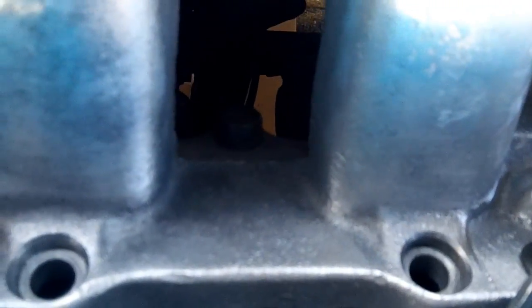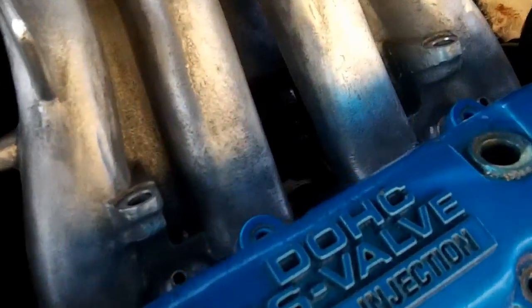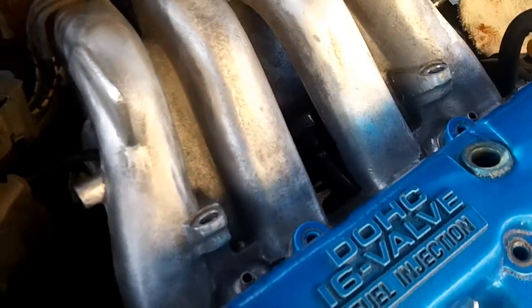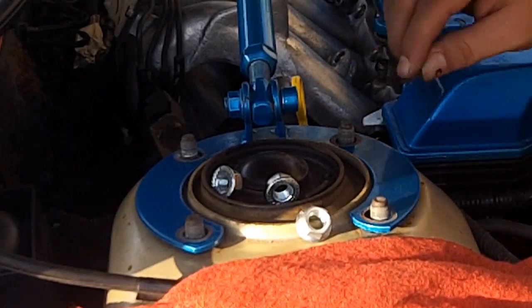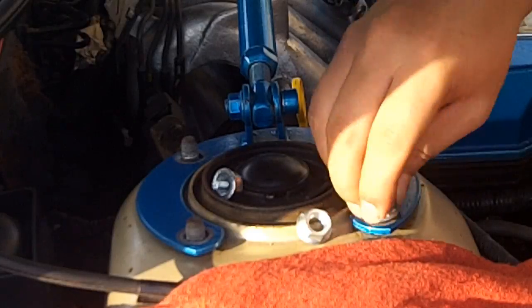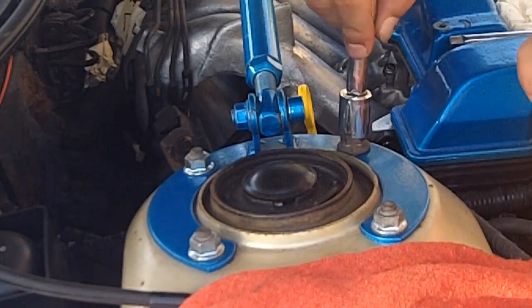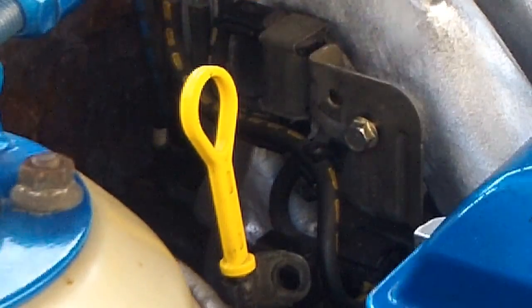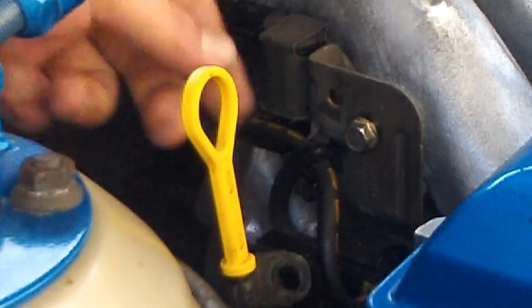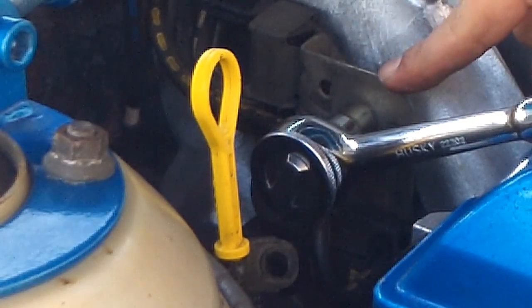You've got one bolt there, one in the middle, and one on the other side right below this runner — so that's five bolts plus the two washers. Now that all the bolts are connected, I should be able to finally install my strut bar — 14 millimeter. Now that the intake manifold is bolted down, the EGR you get to from the other side, so now we're ready to start reinstalling. Both of the bolts that hold this bracket on are 10 millimeter.